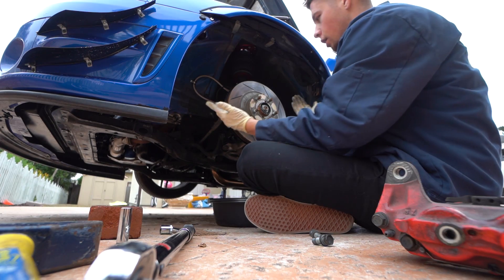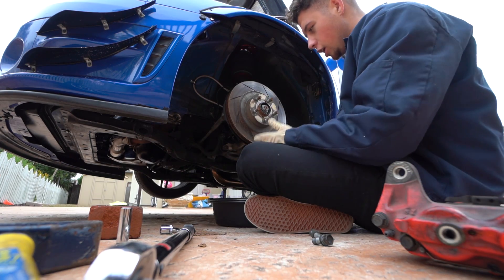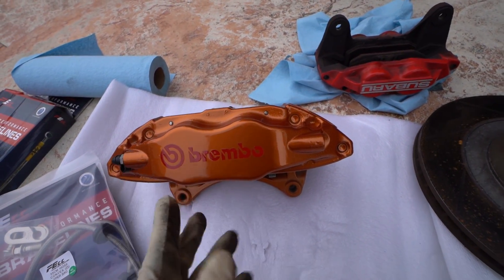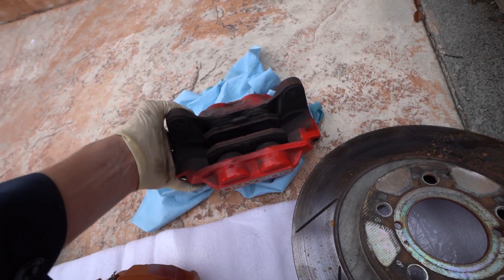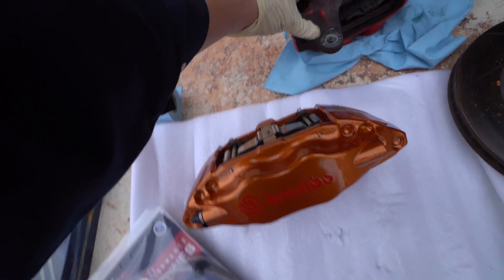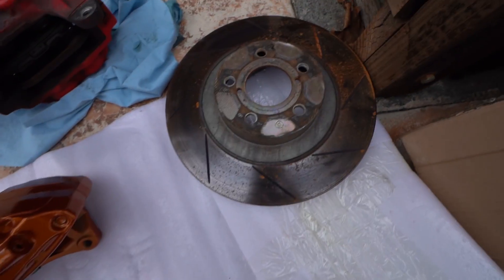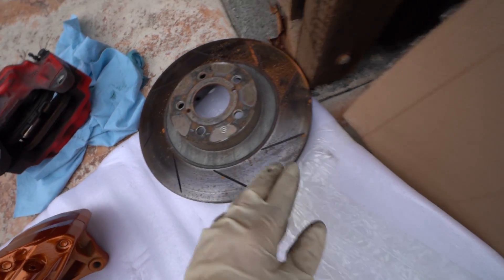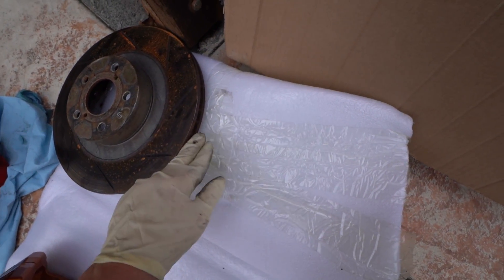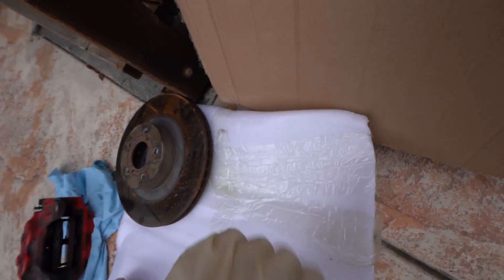As far as the rotor itself, all you really need to do is shock it loose, so I have a hammer here — just a little tap and it should come loose. You can really see the actual size difference now. Little guy, big boy — you can pretty much see the difference. I basically had to end up just hitting it on the side to shock it loose. I tapped it across as well — just rotate it and hit, hit, hit, eventually it comes off.